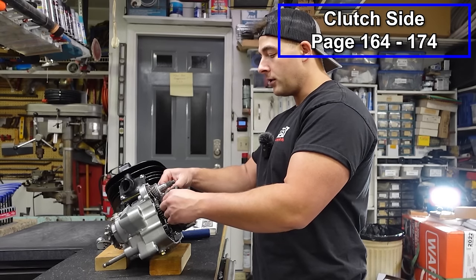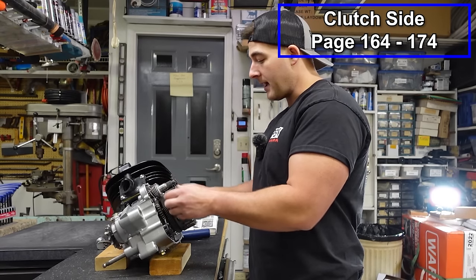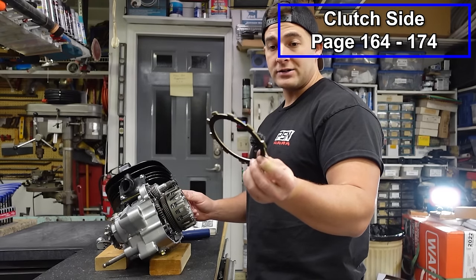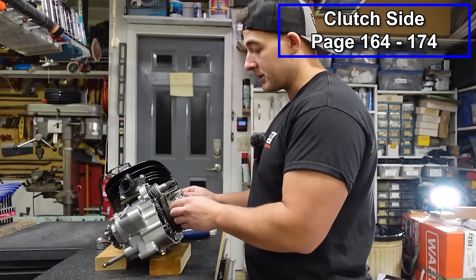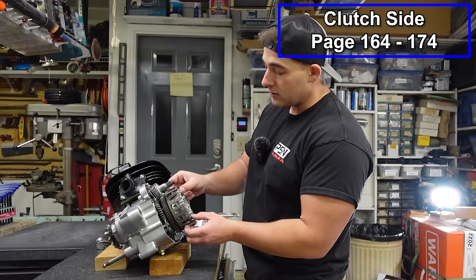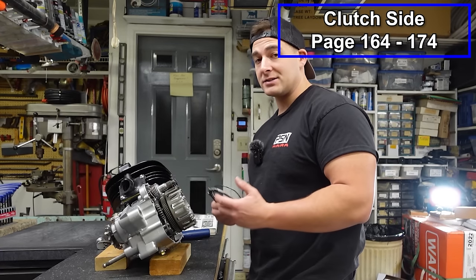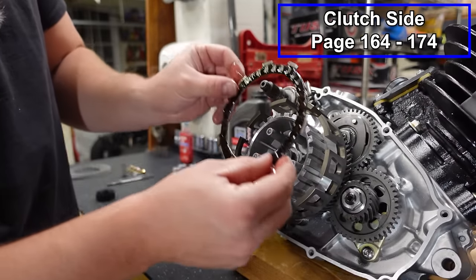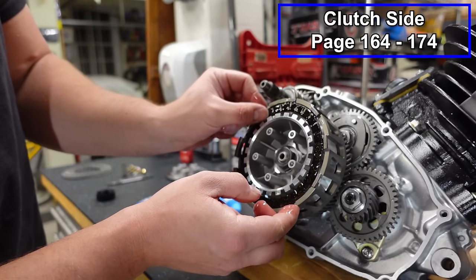So what you do is replace that half fiber with another full fiber. Basically I just order an OEM one, or if you pull a clutch pack out and it's in decent shape, you can reuse one of those. And then you've got a little bit more clutch performance, and honestly, I never really feel much of a difference at all in the clutch. We're gonna try to make the least amount of mess as possible. And then we're gonna slide this in.